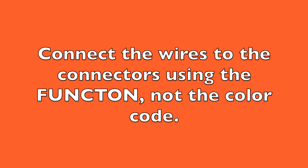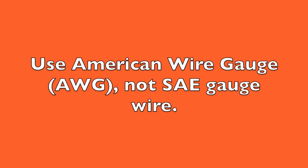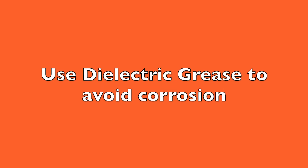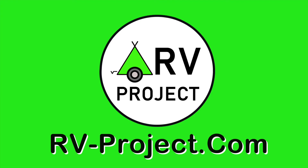What I typically do in 7-pin wiring situations is mark the function on both the connector and the wire, and wire the two together using the function map rather than going by the color code. Ensure that you use American wire gauge (AWG) wiring. Avoid SAE gauge wiring. Label everything, including connectors and wires, and do a continuity test on anything you're not sure of. Finally, use dielectric grease on all the connections to eliminate corrosion. Visit rv-project.com.